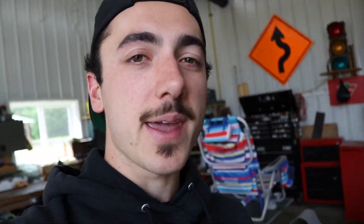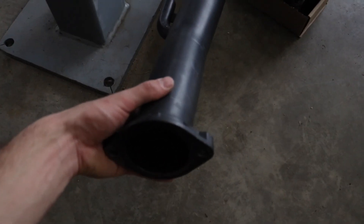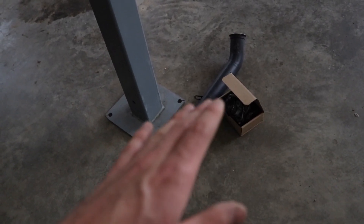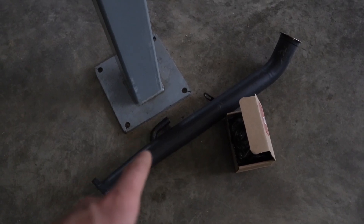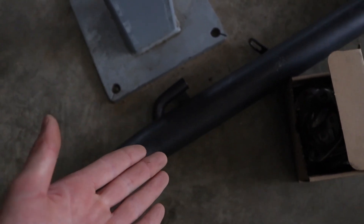He did a whole bunch of stuff underneath the car as well. We actually had to cut my down pipe two and three quarters of an inch, and then the original extension piece for the down pipe was hitting my cross brace for the transmission. So we had to build an entire new pipe — this is the pipe with the mount for your wideband sensor, it mounts up to the little mount on your transmission, has the two bolt flange to bolt up to the catback, and then the V-band for the down pipe. This did not work at all with my setup, and another thing I didn't like was that my wideband sensor was sitting in this little cheater tube, meaning it isn't completely in the exhaust stream and doesn't get a proper reading.